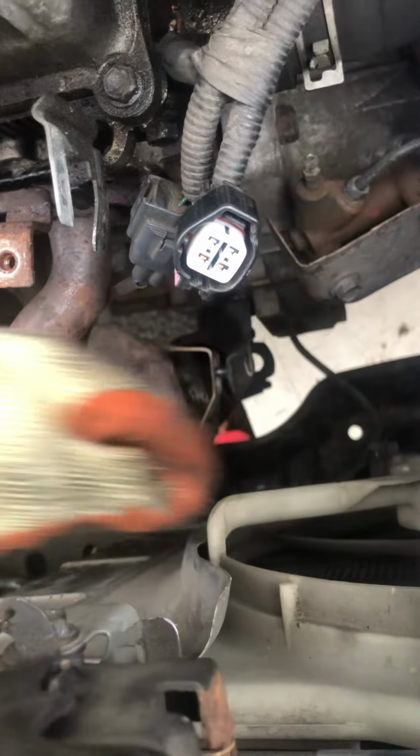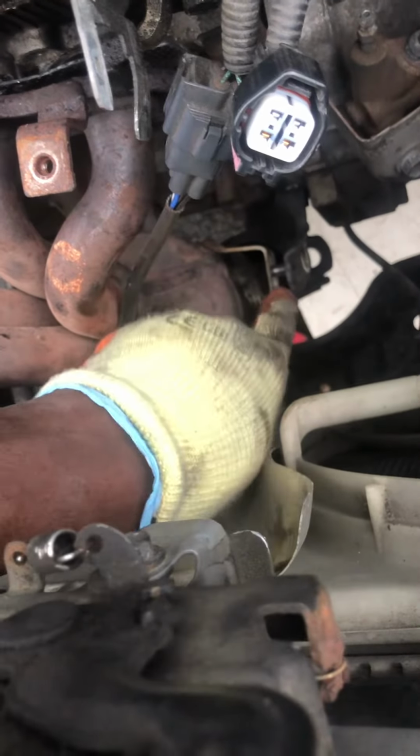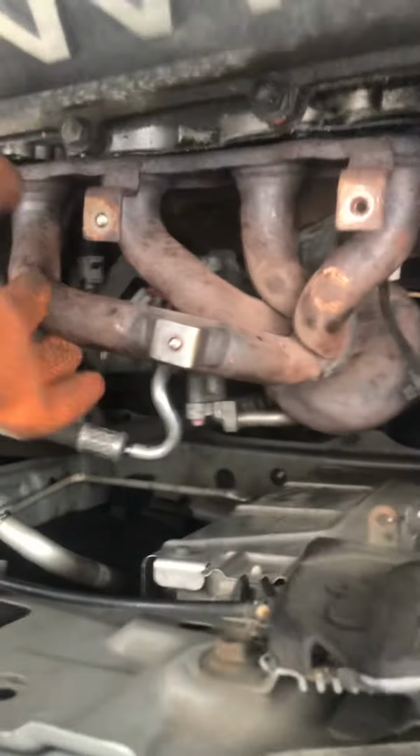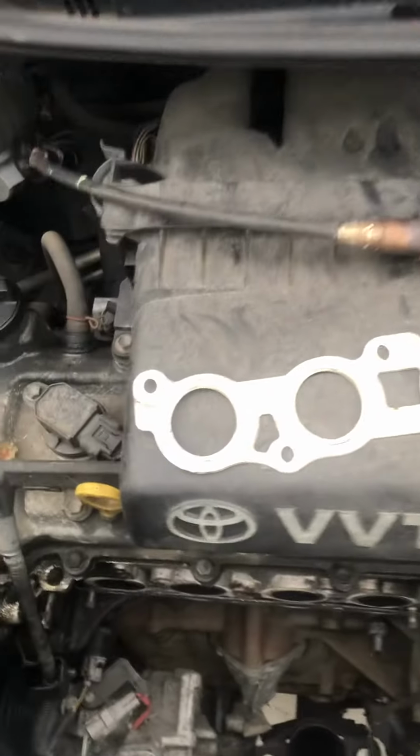I don't know if you can see this metal plate. This one. Can you see that metal plate here? So it needs to come off sideways. If that screw is too tight, it will not come out. Thereafter, remove all the screws and just lift it out. To put back, that's the opposite.